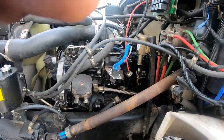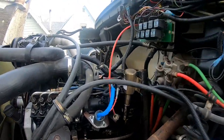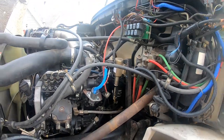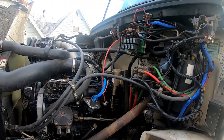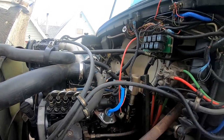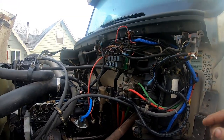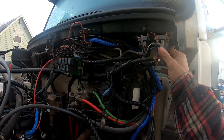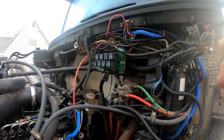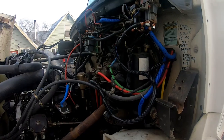But it's cold enough that I'm not even, as I've left this out before, this new truck. And this truck didn't come with a grid heater on it. So a little story here. When I got sick early this winter, I had another 12-valve Cummins, a 12-valve with a VE pump out of a pickup. And that 12-valve had a grid heater on it. This one did not come with a grid heater. So I robbed the relays off that engine, and I put this grid heater in here. I was in the process of wiring it when I got sick. Anyways, got sick, didn't finish it.